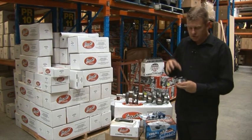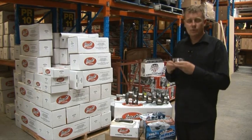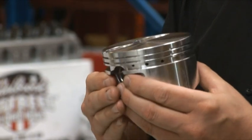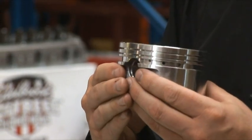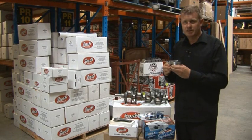If detonation occurs, you can actually damage the piston like you wouldn't believe and punch a hole straight through it. A forged piston like this one here is very, very durable — it can actually withstand quite a bit of punishment — and this is why you need to upgrade to a forged piston in a racing or high-performance application.